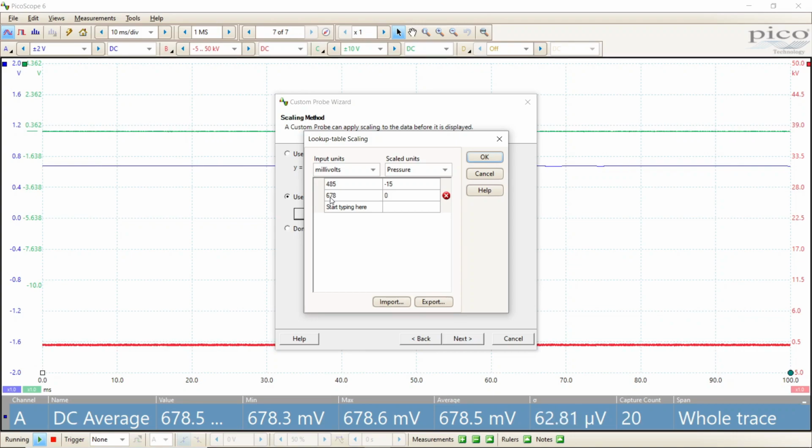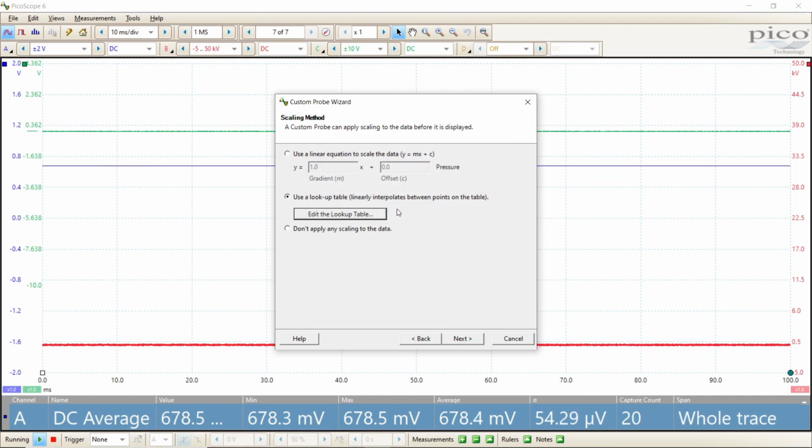converted to gauge, basically, so that way we can use 0 as where we're starting. And then our 4500 millivolts is going to be equal to 285 psi. The reason why we do that is the difference between negative 15 psi and 285 is 300 psi, and that is what this gauge is, a 0 to 300 psi absolute sensor transducer.